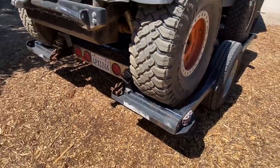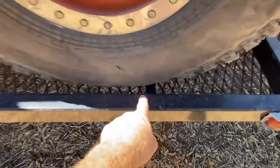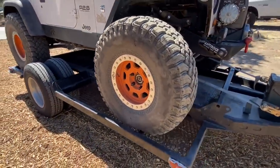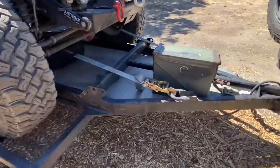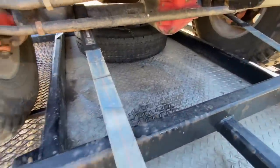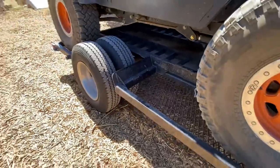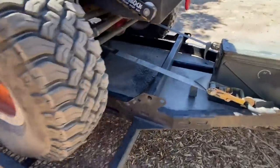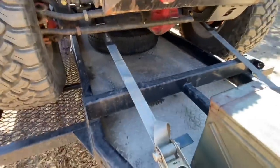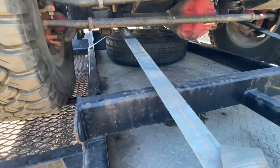There are ramps, but most of the time when I'm loading the Jeep or a 4x4, I can just drive it right up in low range. Here you can see how this tire is not sitting in front of this front brace — it was kind of built for about a 103 or 104 inch wheelbase. The tube sock Jeep is a little bit shorter than that; I've had Jeeps up to 110 inch wheelbase on here. It does have trailer brakes, an ammo can for straps and storage, and a spare tire that rides inside. The ramps are tucked up inside there so if you have something without low range or big tires, you can still get it on. One issue is the frame rail width is a little too wide for a flat fender or really narrow vehicle — I've had to park them kind of cattywampus. On a future one I might make the rails a little closer together so you could fit a narrow track vehicle.